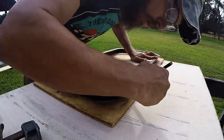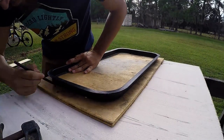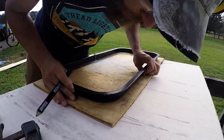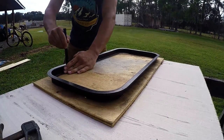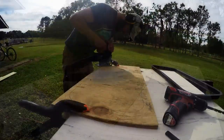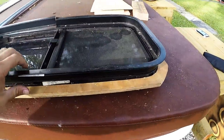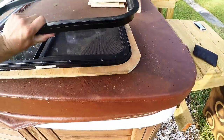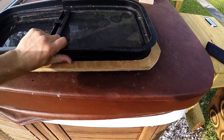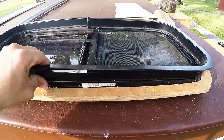So this is the template-making process. I want to be very certain to make my inner dimension exactly right — the outer dimension is not as important as long as it hangs over an inch or two. The reason I'm using plywood is because it's a little bit flexible, and I can stack combinations of ½ inch, ⅜ inch, and ¾ inch to get that perfect amount of sandwich material. I've made the one I'm going to use as a template and it fits all around — now I need to make probably five or six more so I can sandwich them together when I screw the framework together.